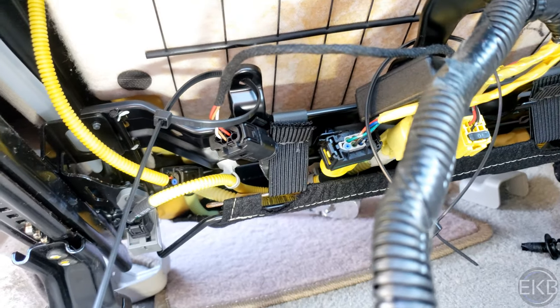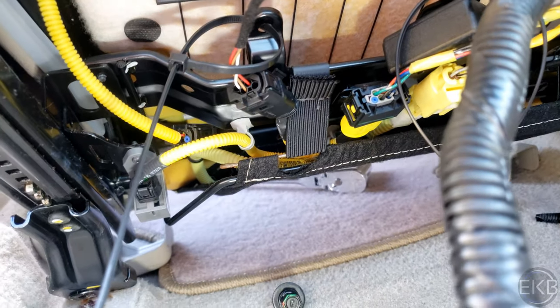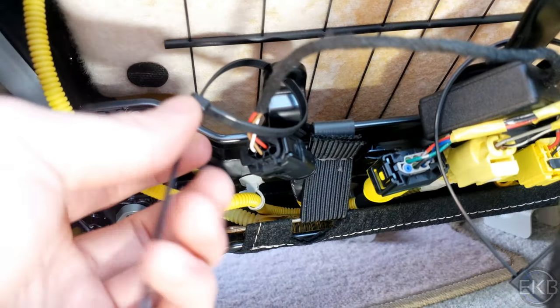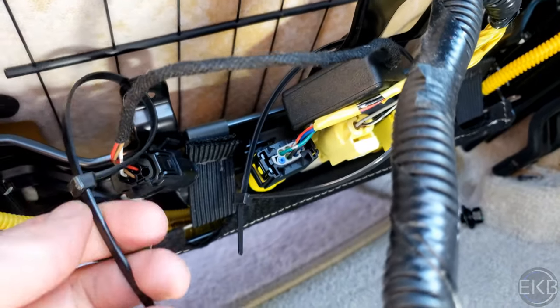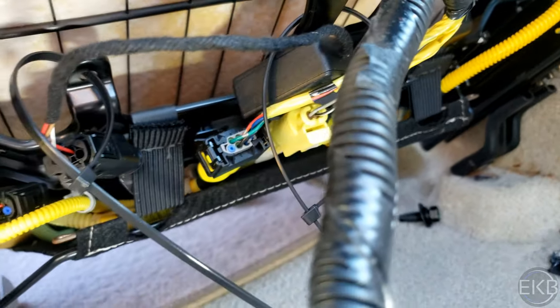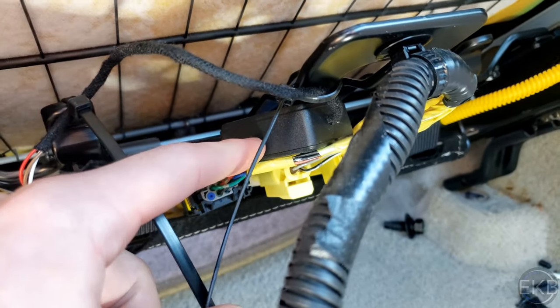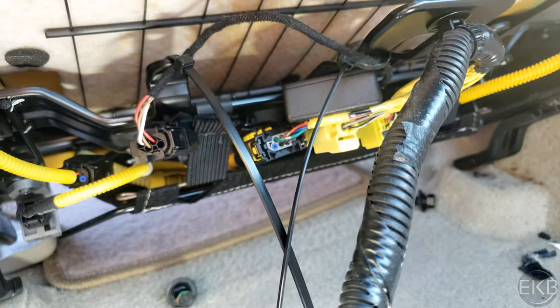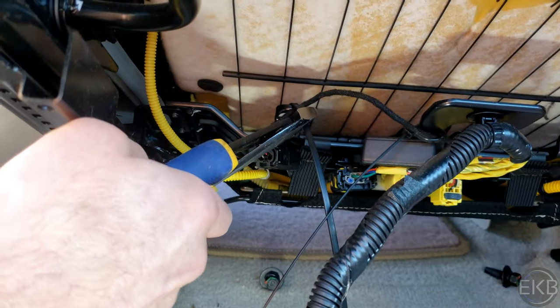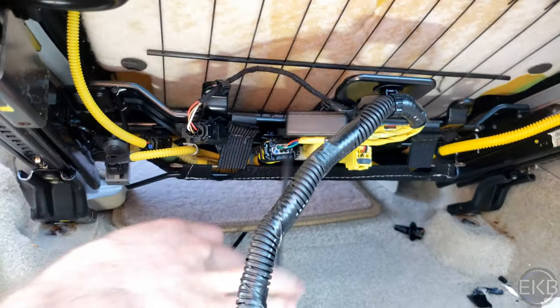Another reason why we disconnected the battery is because you don't want the airbag to accidentally go off while you're working on this. Shouldn't happen, but better safe than sorry. I put some zip ties — one through a hole right here going around the wire, and the other one is through this bracket right here. You may or may not need it depending on where you want to secure it, but I also shoved the emulator between all the yellow stuff. Tightened it up and it seems to be working out pretty well in terms of holding it in place. Being shoved between the yellow keeps it from moving, and the zip tie keeps the wire from moving too. Just make sure the wires aren't being pinched at a bad angle and you should be good.